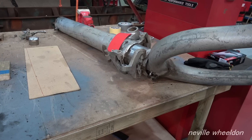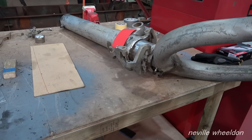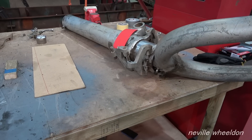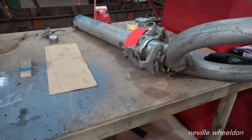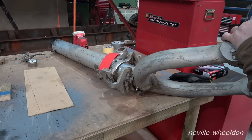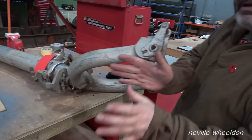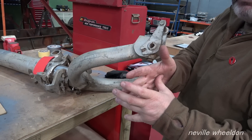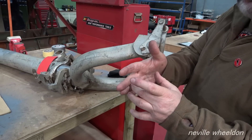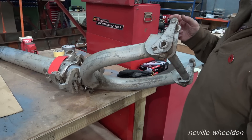Norman's contingent is doing a strip-down of the earlier unit and its damper. It's a little hydraulic damper — like a blade on the inside of it with a little hole in it, so it dampens the oil going from one side of the blade. It's called a rotor inside — it's a little pot with a rotor in the middle of it. As it wants to shimmy, because there's a tiny hole in the rotor itself, it slows the rate of oil going between the two sides.